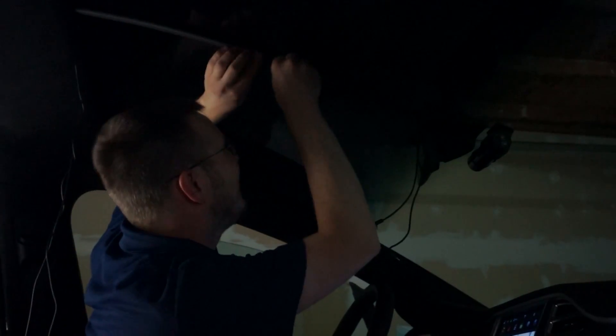Let's see how 25 inches works out. You can cut the channel with plain old scissors — pretty easy. You're going to want to make it a little bit shorter than 25 inches, probably 24 and a half. I ran both the cables through here and decided to put the side with the slit towards the OEM channel so you can't see it — it gives a cleaner look. You're going to want to run the cables towards the driver side because we're going to tap into the power down by the driver side kick plate. There were a few spots where I didn't get it quite as close together as I'd like, but you're not going to notice unless you're right underneath it.